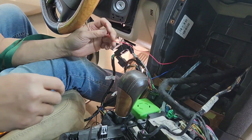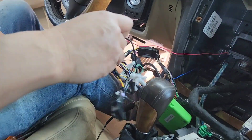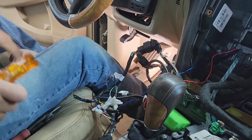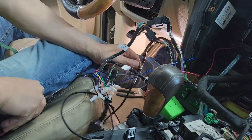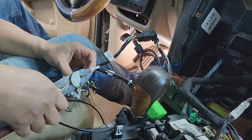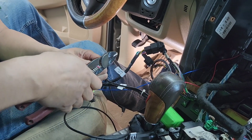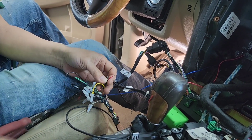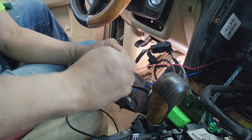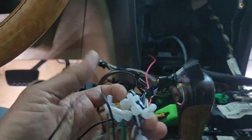So I fused it — just in case, you always have to fuse it. Then I'm going to cut the red wire of the Pioneer right here, because it's got a short and we don't know where the short is at. The best way to do it is just to bypass that whole thing completely. Make sure you tape the end of it too, so that way there's no exposed short. He did try to look at the accessory wire thing. Then put that red wire right here. Now I'm going to put the radio back in and see if it works.